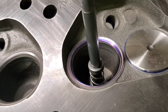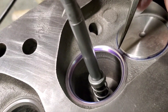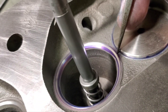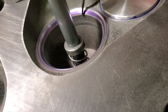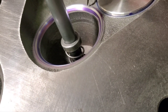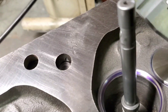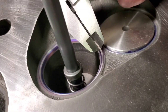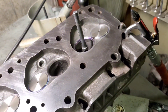Here's our first intake seat. We've got three angles here — our top angle, our bottom angle, and it blends into a fourth angle. And then this is our seat angle, and this is 50 thousandths. I'll continue on and be back.